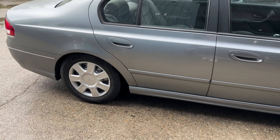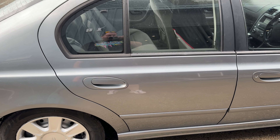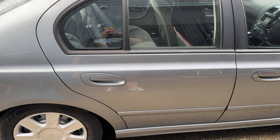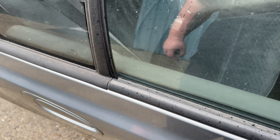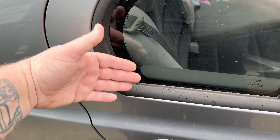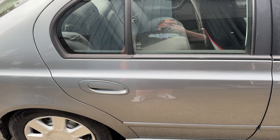When I first got the car, this external door handle didn't work. Then while we're cleaning it, I think we flicked the child lock on, so the door does not operate at the moment. We're going to have to get the car-stealing kit out and bust that open — either go through the window channel here, or put an airbag in and pull the door apart and get a rod in there to flick the child lock off.